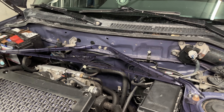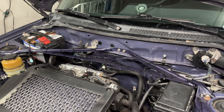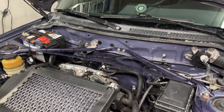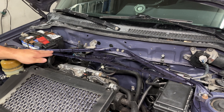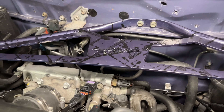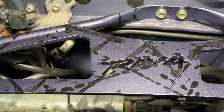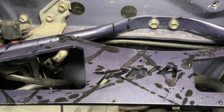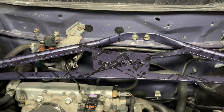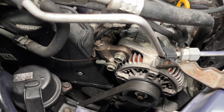Tell me about this strut brace. This is the OEM option Toyota strut brace that you can get on the later '98-and-up RAV4s. I just added this center bit here to strengthen it up a bit and add a little flare to it. I cut that piece out on my CNC plasma table and just welded it to the factory brace and repainted it.